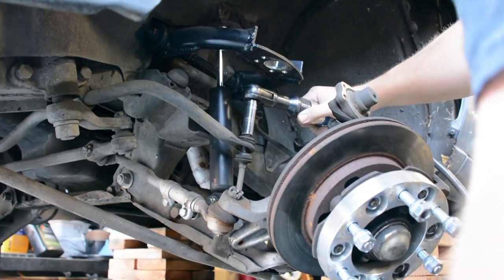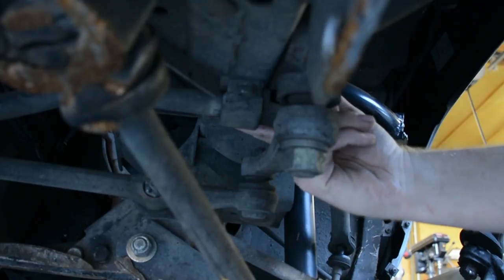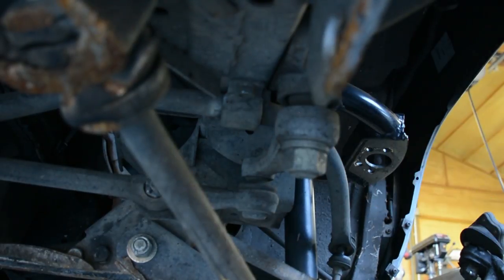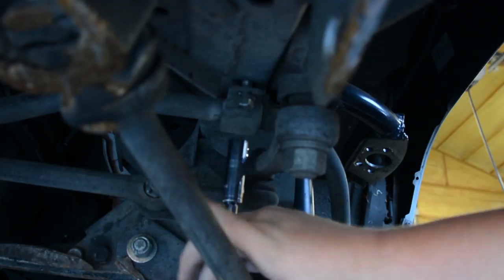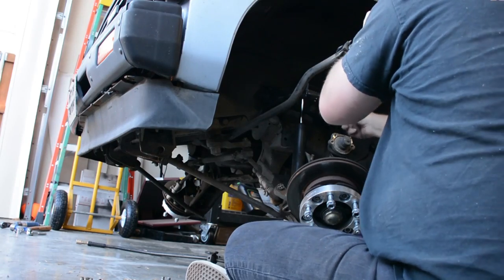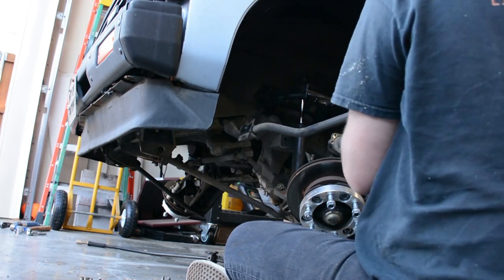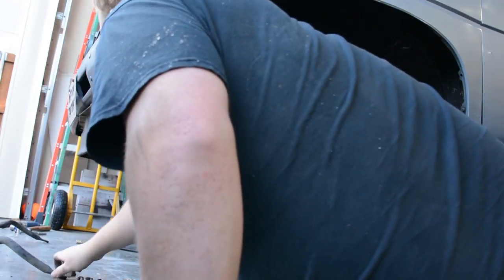As long as you have two separate airlines going to each bag, you really don't get much body roll. Under the frame there are a couple of mounts on either side to take the sway bar completely off, so we'll just undo those and pull the sway bar out — a little bit of a pain, but we get it out.